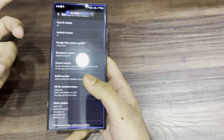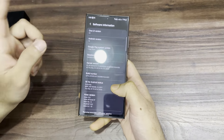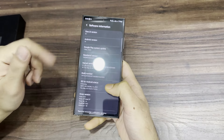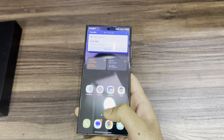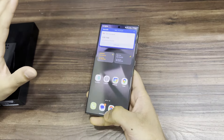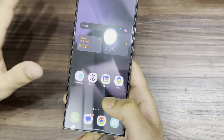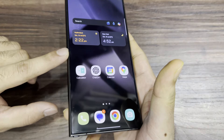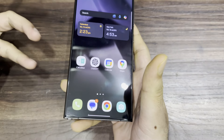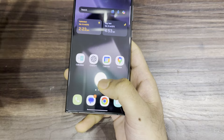Talking about hardware, it's an incremental update. The display has increased brightness — it's a 6.8-inch QHD+ Dynamic AMOLED 2X display with a 120Hz refresh rate, going from 1Hz to 120Hz with LTPO. The glass quality is Gorilla Glass Armor, and the peak brightness is around 2600 nits. It's a flat display, which many people prefer for gaming due to better compatibility. For performance, we get the Snapdragon 8 Gen 3. The prime core is overclocked to 3.39GHz, while the other seven cores are lower for heat management.